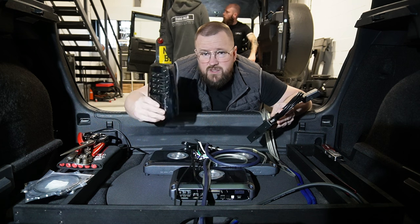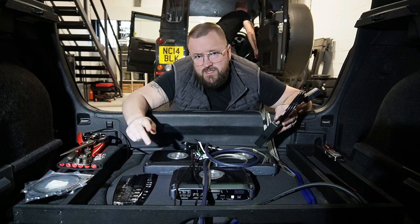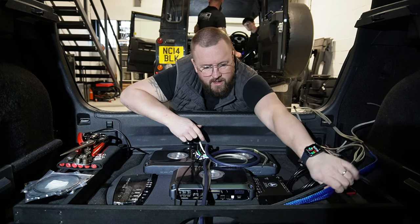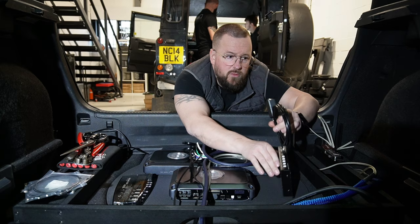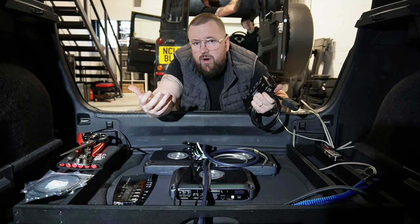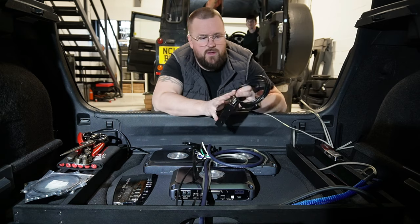I've got my distribution — big old massive connections distro. I've had this in about 50 cars. That'll be going there for power and earth distribution. I said we were going to independently ground these, but I'm going to take them to this distro and then pull them out of that distro to the car somewhere. Now I've got to trim down some of the cables and get amongst it, but I think I've found my layout, which will be a VXI hub along here. This is the BTC — the Bluetooth controller — so any laptop, iOS app, or Android app, you can go straight into the Tune software and set up your system that way. You can save it to the cloud or to the device. I'd save it to the device, but that's just me and my tin hat.